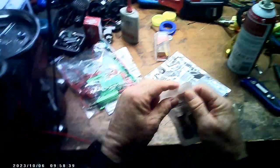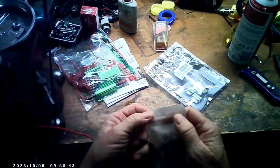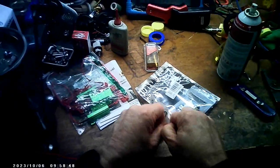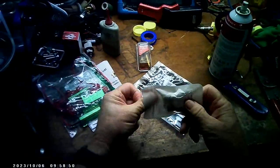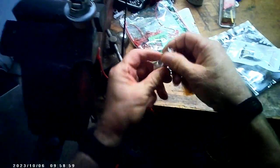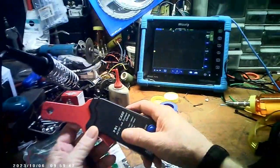The problem with LEDs is they're polarity sensitive. If you happen to have the wires hooked up backwards on your vehicle, that's what I want to know. I'm going to pull one of these bulbs out — it's still the wedge type, just like we had before. I'll put this one in here. Wow, that's nice and bright. Full load equals 10 milliamps.